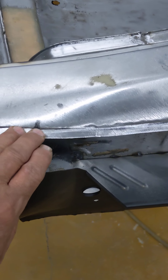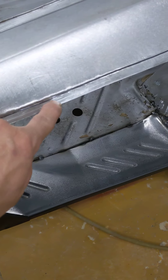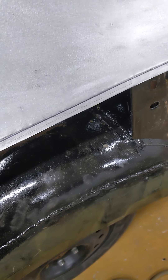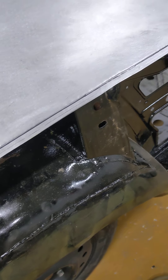I got the quarter panels all fitted. That's what today's job is going to be — to get the quarter panel welded on. I'll make another video after I get that on there. I decided instead of butt welding up here at the top, that what I would do is flange it. So I marked it, cut it down, put a little flange on in there, all along there. I'm just not the greatest at butt welding on big long sections — I tend to warp them a little bit, it has some burn through problems, so I figured I'd be safer if I overlapped them.